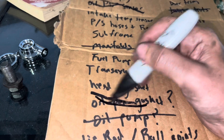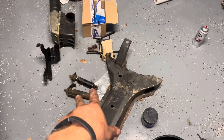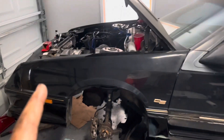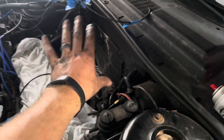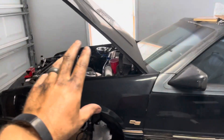Definitely needed to do the oil pan gasket. I wanted to get to the transmission strut mount today but we're out of time — I've got those mounts soaking in used oil so hopefully the bolt comes off after soaking for a week. While the head is still off the car, I want to get to that strut mount and the power steering pump, because once the head is back on, anything in that area really stinks to work on. Once those are done, I'll get a buddy or a cherry picker and we'll get the head on the car so the motor will be 100% complete.